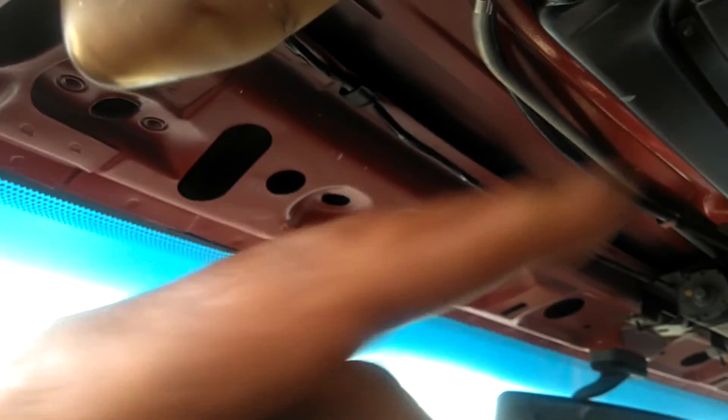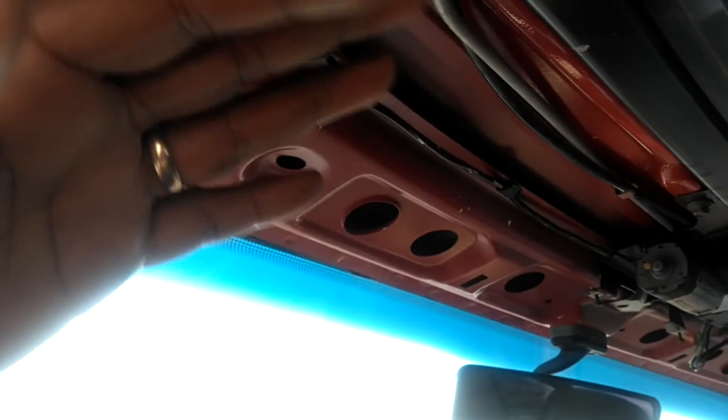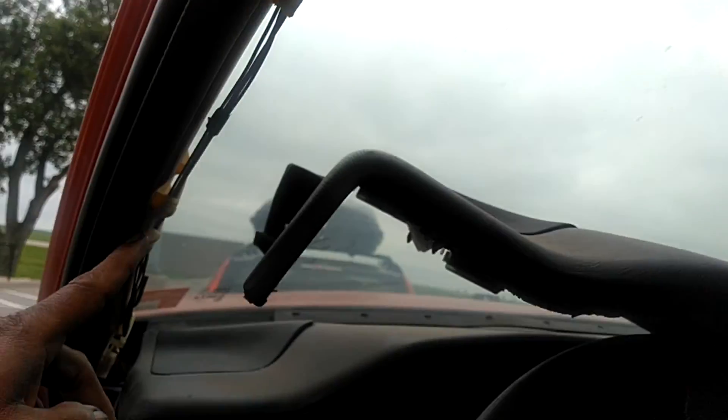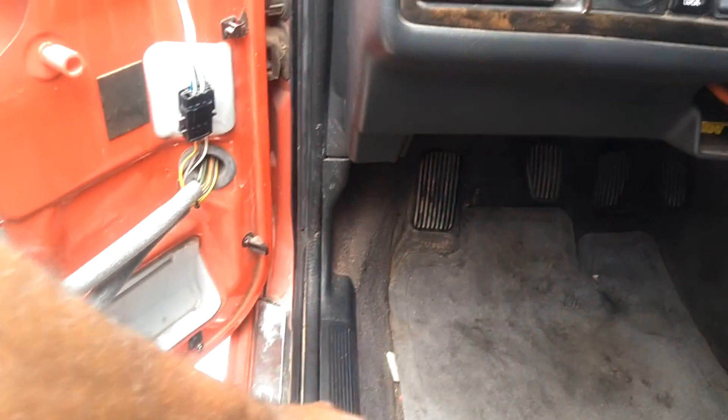As you can see, this drain has a kink in it — that's not gonna work. If water fills that up, it's gonna leak either out the sunroof into the seat, or it'll run down the pillar and fill the floor.